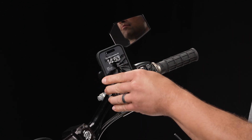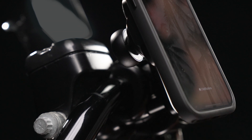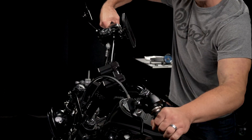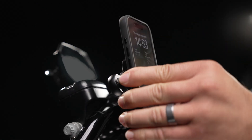Finally, you can tighten the screw on the back of the mount head. Attach your phone in a Peak Design case and turn your bars completely in both directions to check clearances. Also, ensure that the phone doesn't interfere with your controls. You can fine-tune your viewing angle at any time using the friction ball head. If you've got a non-charging version, you're done. Go ride.